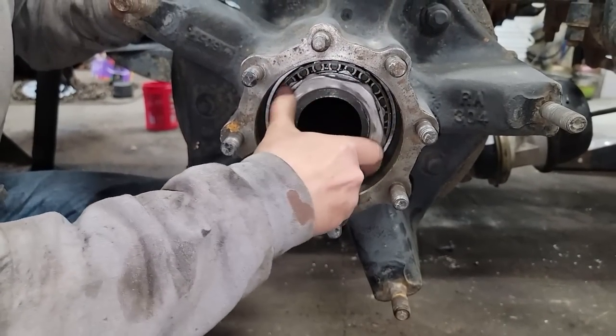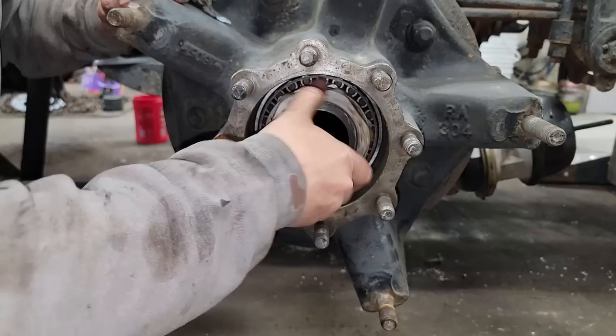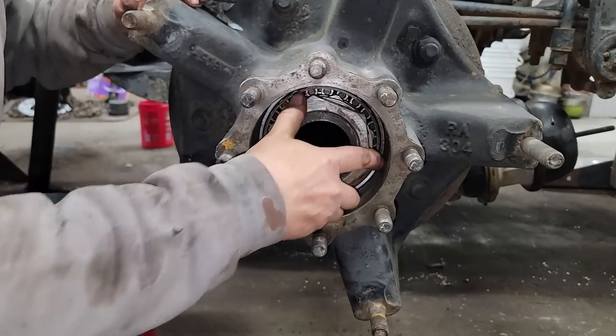the outer jam nut. This is what holds that lock plate in place and backs it up so it can't come loose. This is the Meritor spec sheet, and it says that for any drive axle that uses this type of locking plate, if your outside diameter spindle is 2 5/8 or greater, the torque spec on the outside jam nut is 300 to 400 foot-pounds.